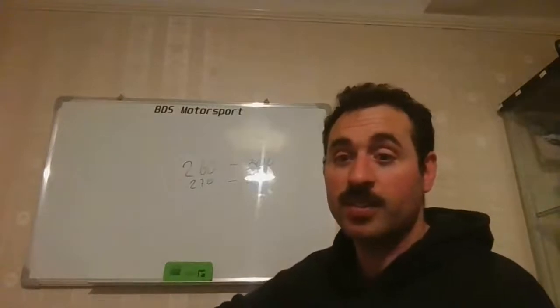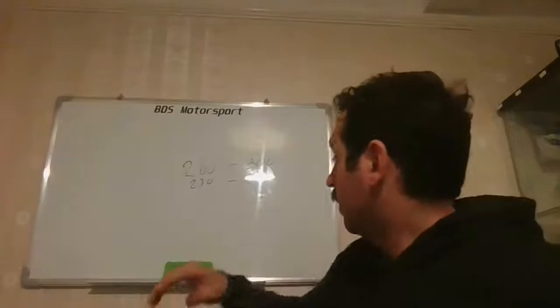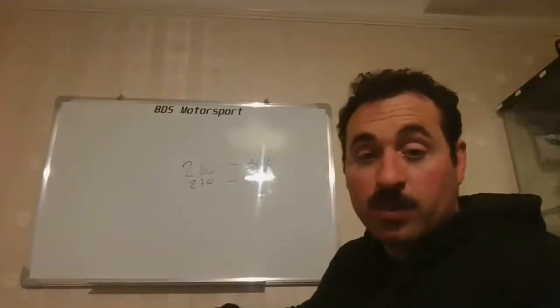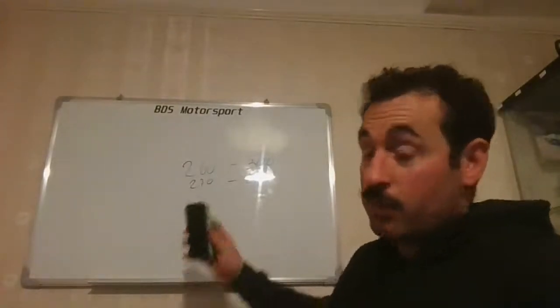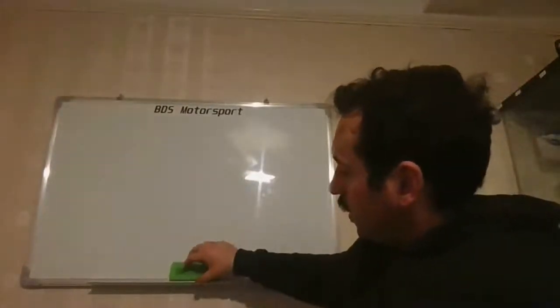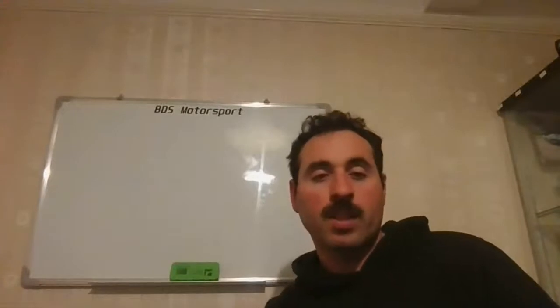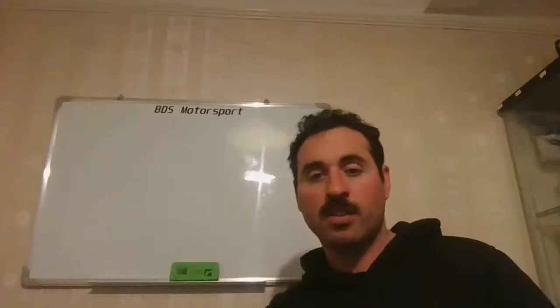You weigh it out and see where you want to be. If those 10 or 12 bhp are that crucial, yeah, go for it. But again, it's the average port speed that is going to make you faster. So I prefer to have a better port speed and always try to find the best compromise. I've covered that area already a lot.